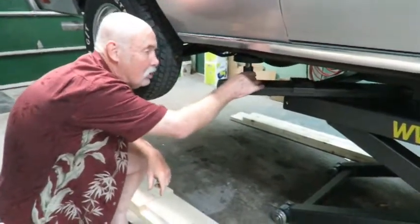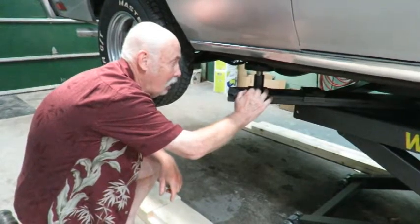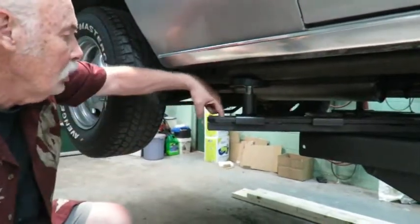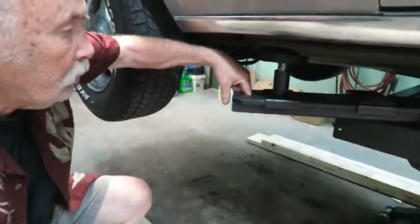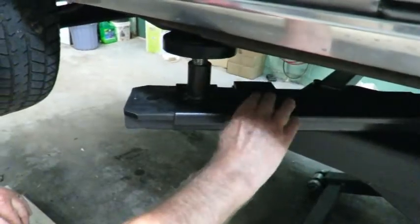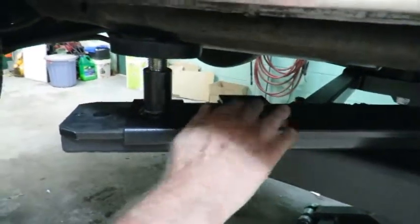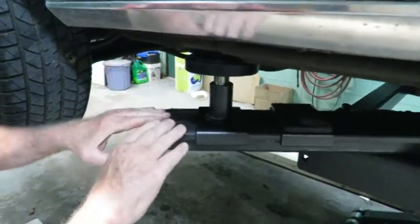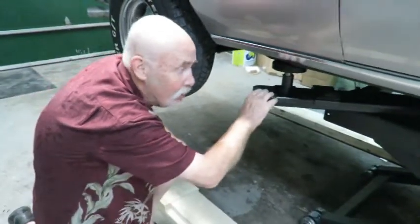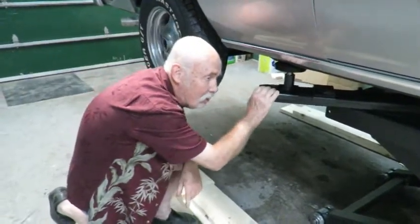There are also different ways of setting up the arms. I'm using what they call a truck adapter here — it's adjustable and threaded. You can also take it out and put it in a different threaded hole as another option, or take these off and just use the base piece, which has a nice rubber protective piece on it too. Or you can remove all of it and just let the frame piece touch the car's frame directly, which works fine if you have a unit body car and you get it on the jacking post. It gives you lots of options.